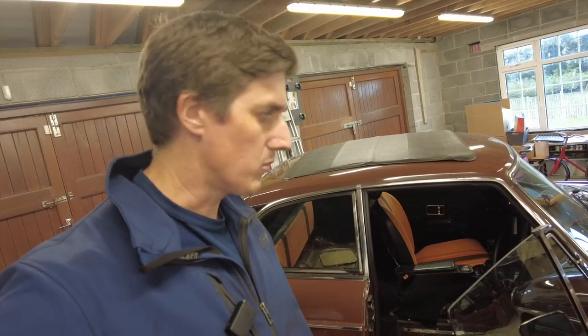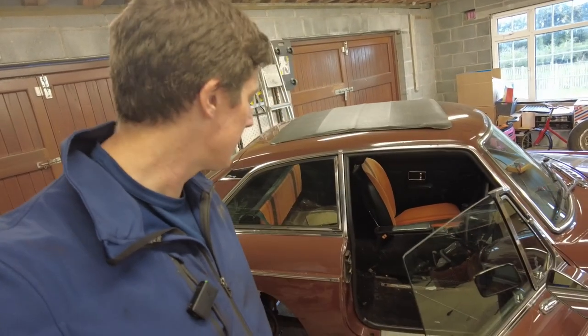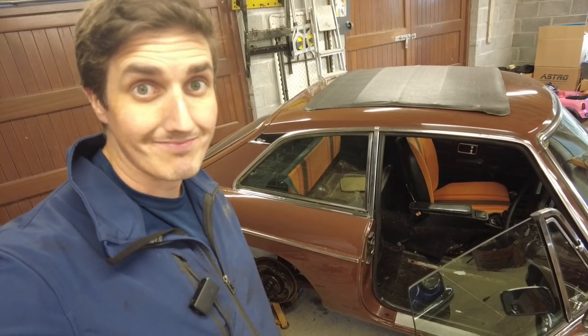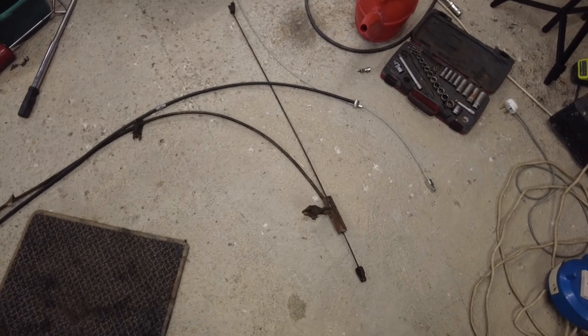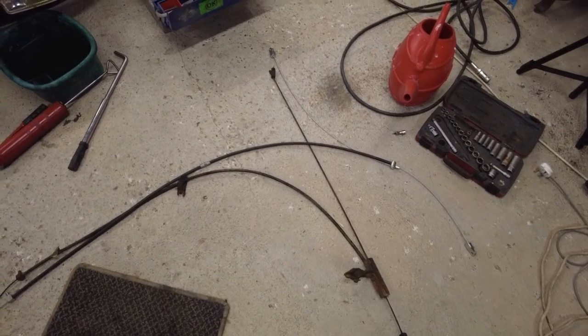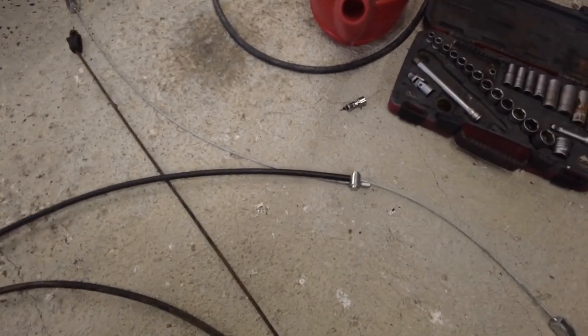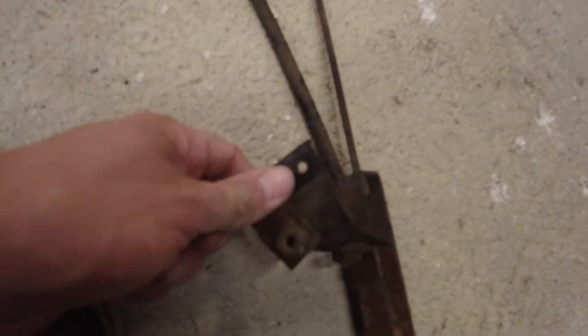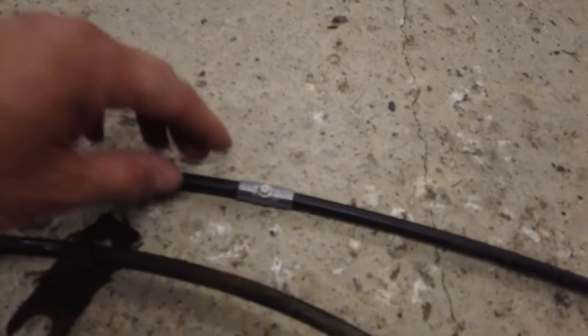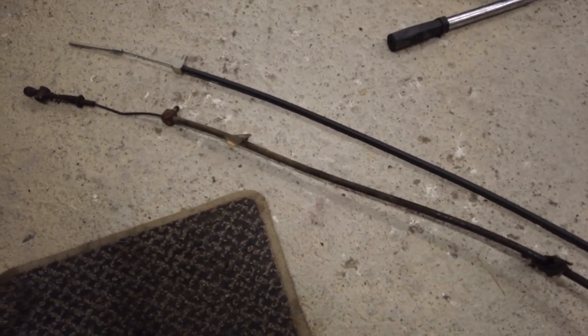We're into the second day of the brake repairs on this MGB. We were working on the handbrake cable - I got the old one out, so it's now time to fit the new one. As I previously explained, there are two different types of cables. I got one even though my car is fitted with the other, but the older type appeals to me more - it has a pivot point properly mounted to the back axle. The new one has this stupid rubber or leather strap arrangement. Also the new one does not have a grease nipple on it, whereas this one does, so we can actually service it - which given that this one is seized up is definitely a positive thing.